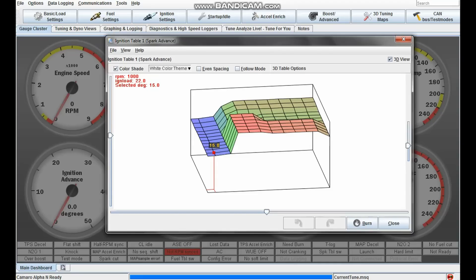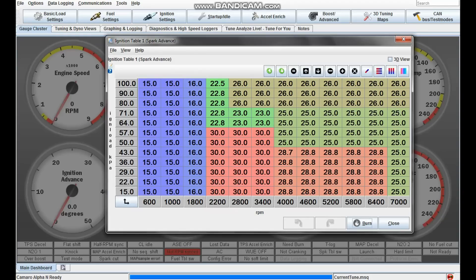How the ignition table works is simple: at low RPM you don't have a lot of timing, and as RPMs increase you want to add more. When I built my first base map, I thought about what a small block Chevy distributor does — it starts at a base timing value of something like 15 degrees and goes up to a maximum around 3000 RPM. I've got 26 degrees here. When you're starting out tuning, do 22 degrees at 3000 RPM and past. For the other areas of the table, do some Googling and slowly work the table into shape — you don't have to start with anything too crazy.